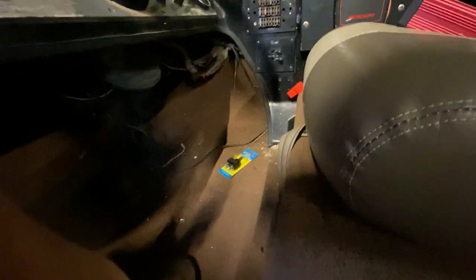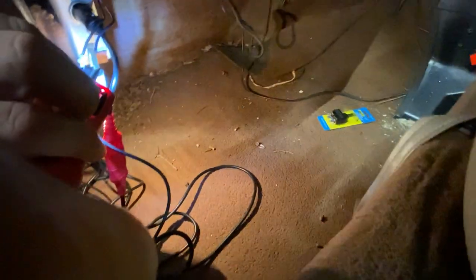The problem I'm running into is I flipped the switch and the light's not coming on. So the first thing I can do with the power probe is I can run over here and get a good connection on this light. I can hit the button that sends power to it, and I can see that this light works.